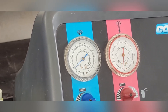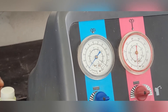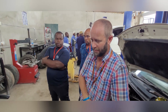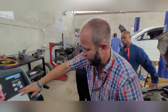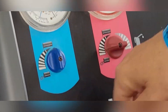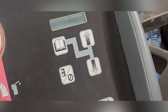Now we can actually open up the system without losing any gas — till now we have not lost any gas, and that is environmentally friendly. It's the way it's supposed to be, and it's secure now. You can see the pressure on the high pressure side is down, and the pressure on the low pressure side is also below zero. It means we can close the valves, switch off the machine, and take off the pipes from our system.